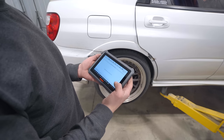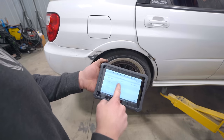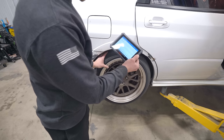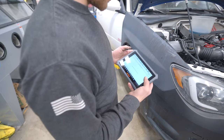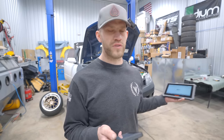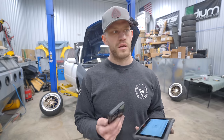I'm going to head into the ABS system. The cool thing about this being a Bluetooth unit is we can go around and individually check each ABS sensor to make sure it's reading. I went into the live data in the ABS system — we have all the wheel speed sensors. If I spin this — okay, we are getting a readout, which is good. That one's reading fine. Now that we've spun all the wheels, let's read the codes again. Until we can actually drive this thing and get the ABS to trigger a code again, we can't really diagnose anything. We had code 28 — the rear left ABS sensor. I'll do a visual inspection on that. We had the CAN communication error, which could be a tricky one — I'll have to wait and see if that triggers again when we drive the car. And then we had the lateral G sensor code, which we can check live data on when we go to drive the car.